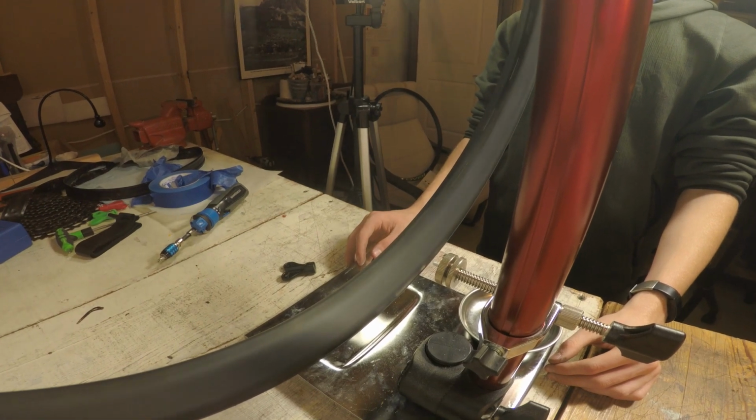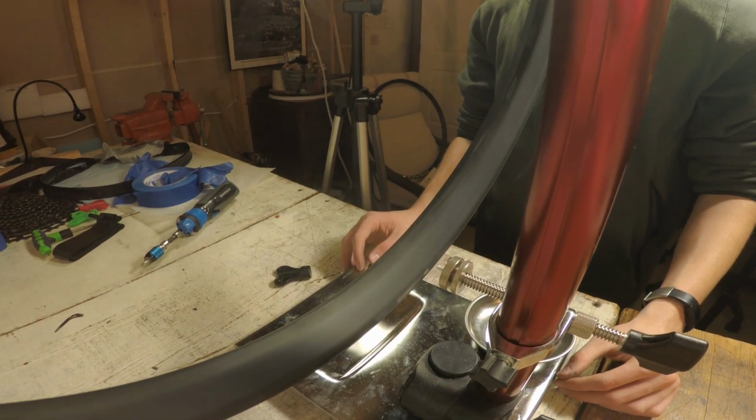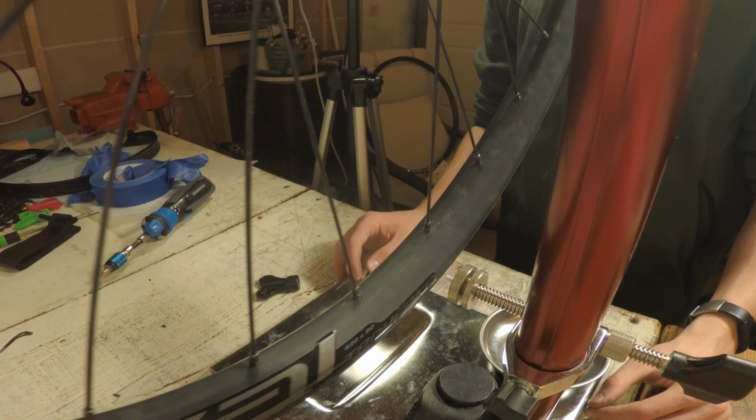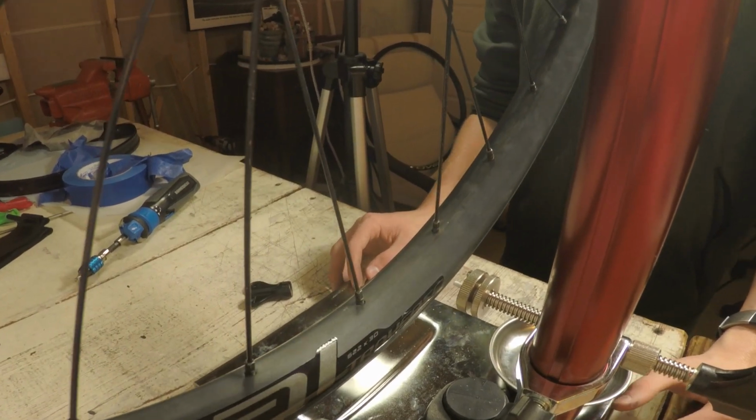It's off by 1/8 of an inch. So if I were to move it to the center, then I would move it over 1/16 of an inch. That means loosening one side, tightening another, then re-truing it. But for this project, I'm not going to do this.